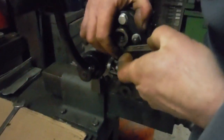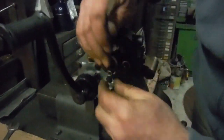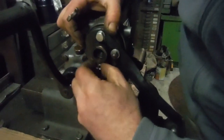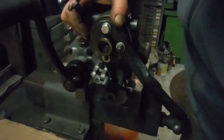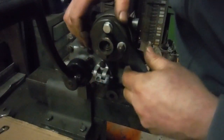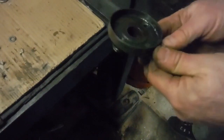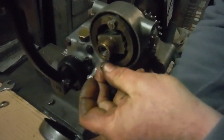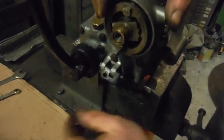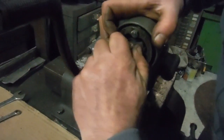This separates the gear lever from the mechanism it's bolted to, and then we'll be able to have a look inside. This all took quite a bit of figuring out, because all I had was virtually nothing between this and the selector arm. That hole there goes over this stud and moves this mechanism, which is something I pinched from a much later Royal Enfield — we've been improvising here.